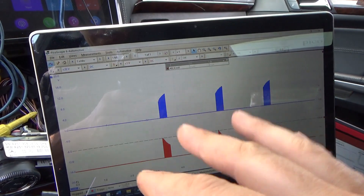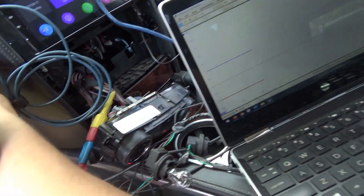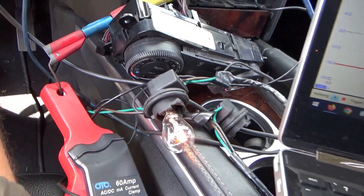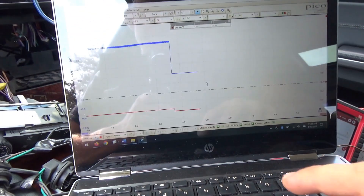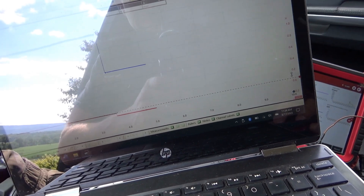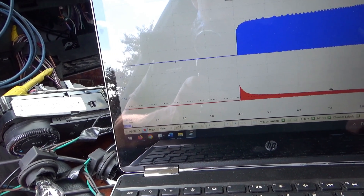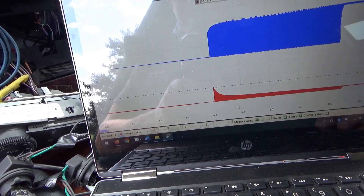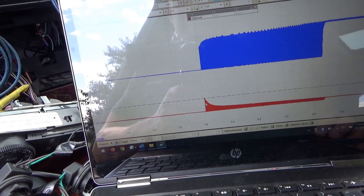Third experiment: let's do 800 milliamps. I took one bulb out — this is half an amp. The bulb is lighting up, controller is happy at 100 percent. Key off. Our amperage is about 50 millivolts on the shunt, which is about half an amp. With the old controller, initial amperage was two and a half amps while the filament was heating up — totally happy.